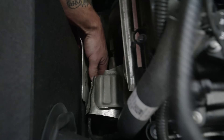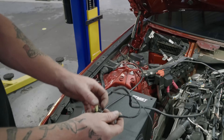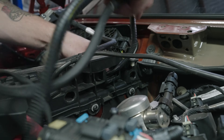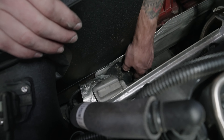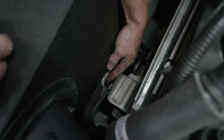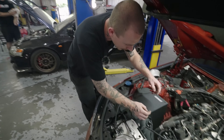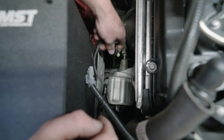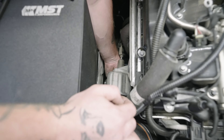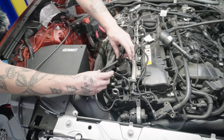Use an 8 mil. This is going to run down to the crankcase vent heater plug, which is just behind the electronic wastegate plug down here. That's only for a stock turbo — if you have an upgraded turbo, this plug is already disconnected most likely. You would just plug this side of it and then plug this in. There's that heater plug — pop these buttons off. The wastegate harness plug is on the back side, so reach your hand around and feel for it. Unplug that crankcase vent heater plug — this side just plugs into the harness, click. Make sure you shut the locking tab, click.